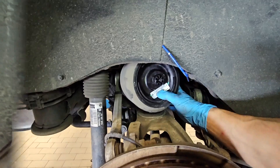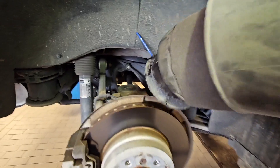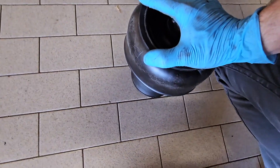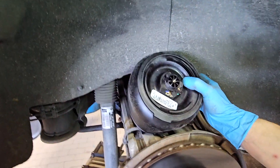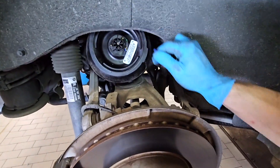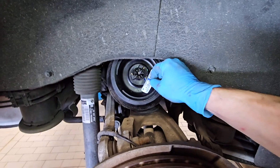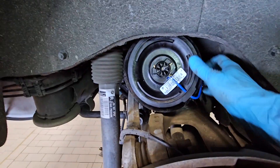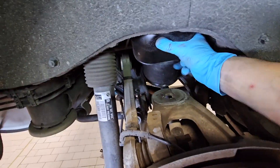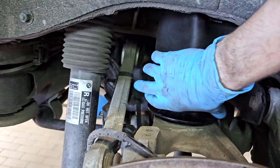I will clip it down. The same process on the other side — this is the right side, and on the right side the line is blue. Remove the safety cap, compress the air bellow to make it smaller. With one hand it's a little bit harder to do. Put back the air line, clean it from dust, make sure it's all the way in, then push it back, twist it, and clip it down.